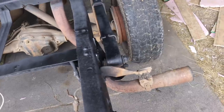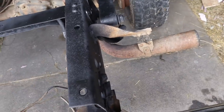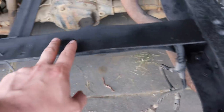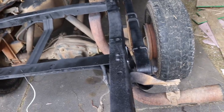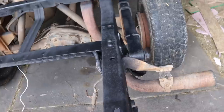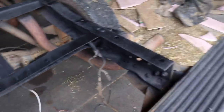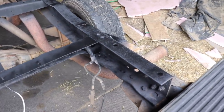People are asking what I did before I coated it. Basically I just took a really rough bristle brush - not a metal wire brush but a more stiff brush - and just brushed off all the dirt. This frame really isn't that bad; it's not pitted with deep rust, it was just really dirty with a lot of little surface rust starting. There really wasn't much to wire brush off, so I just brushed it down really rough, got it smooth, and then coated it.